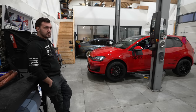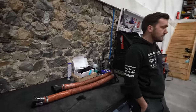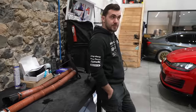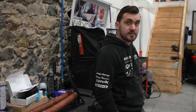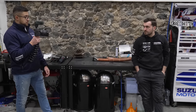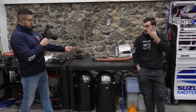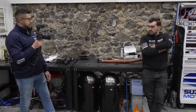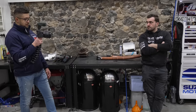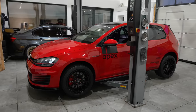On our taxi we saw that proper brake ducting extended the life of braking components by twice or even more. On the G80 we got an extra 80 to 100 laps out of a set of discs. If you drive a G80 — an expensive modern car where brake components can cost two or three thousand euros — and brake cooling only costs a couple of hundred euros, you're literally saving thousands. It's one of the best upgrades you can do.